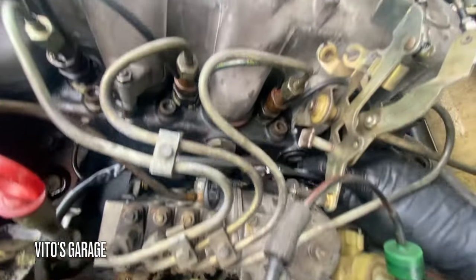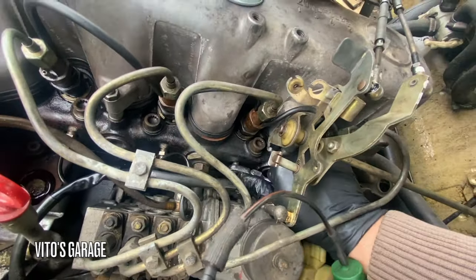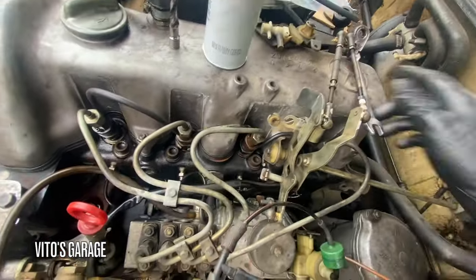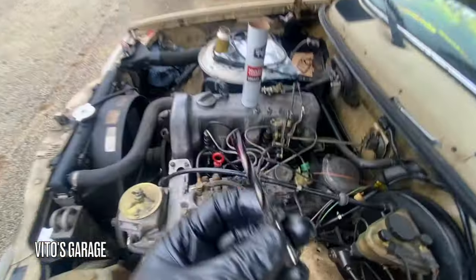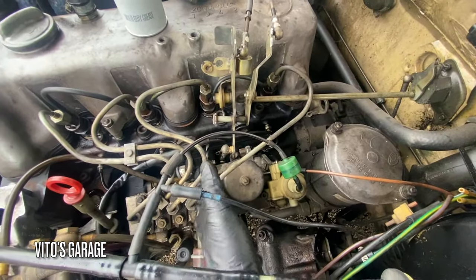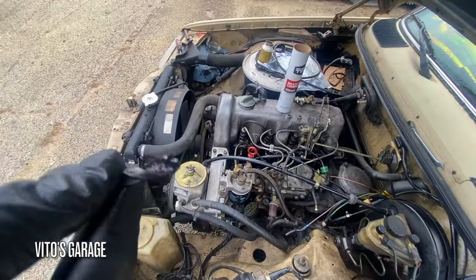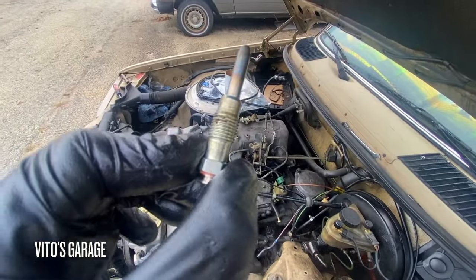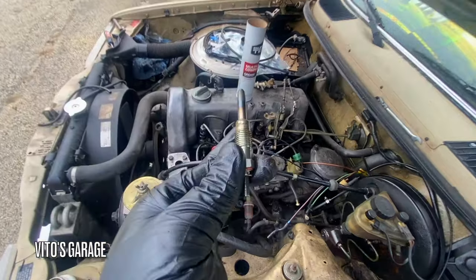Connected these number three and four glow plugs, and I'm just gonna take those out to ream the holes and install good glow plugs in there. Okay, reamer gonna go in. Ooh, this cylinder was a lot cleaner, still some carbon in there. New glow plug going in on this cylinder. I had this one in stock, so installing this one.